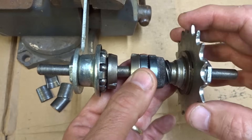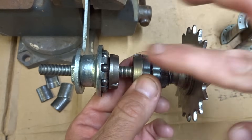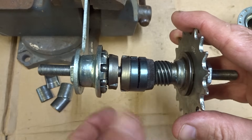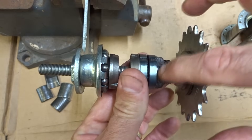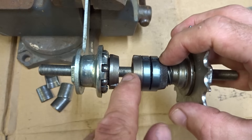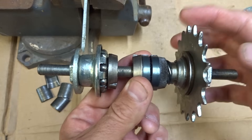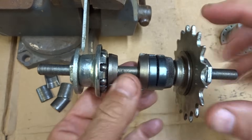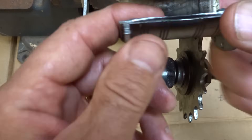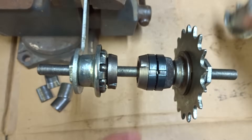Now watch as I turn this forward — this part moves this way. As I pedal backward, this part moves this way. Why that happens is there's this part here which is called the driver. It's threaded into this part here which is called the clutch. There's a spring that's wrapped around the clutch, and then there's another part here which is the driver side expander. So when you pedal forward, this part goes this way and these little notches here on the clutch engage into the inside of the hub shell, kind of grab it and start turning it forward.